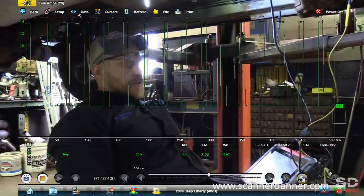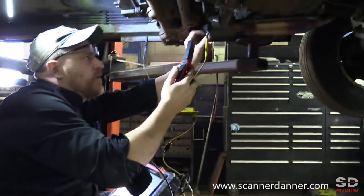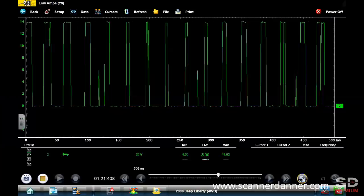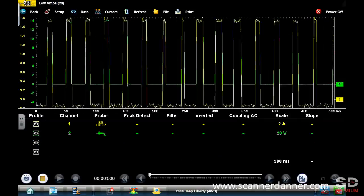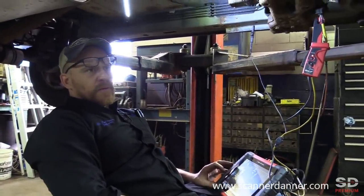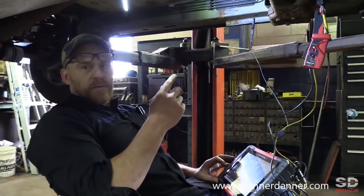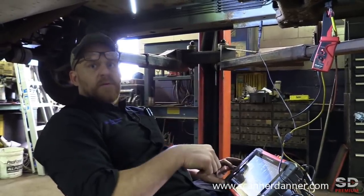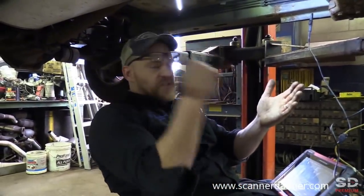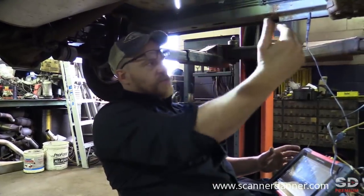Power side switched heater — and if I put the clamp on this we can compare the amperage and voltage on the working one. If it was power side switched, what would the control wire be? This is power side switched. If it was ground side switched then the control wire would be... correct, but it would look the same — still pulsing, because you're still going battery voltage to zero, battery to zero. It would look the same on the control wire. It's the opposite wire that's answering our circuit design question.